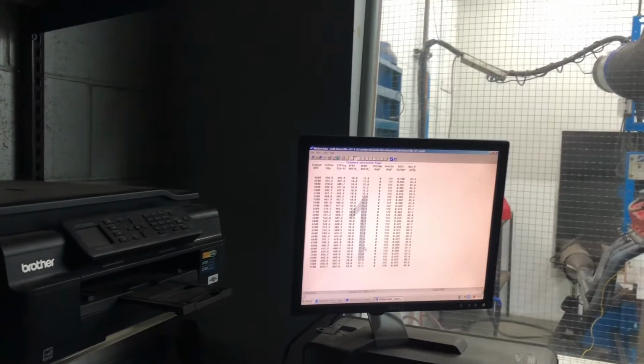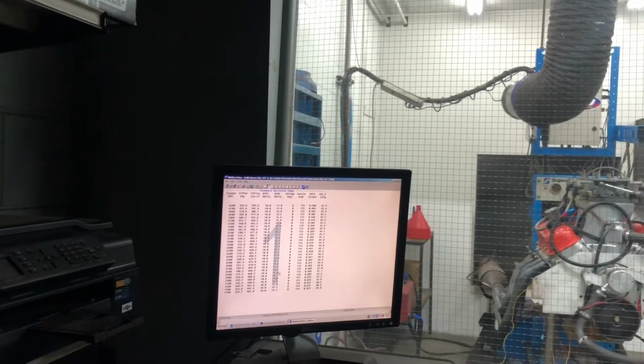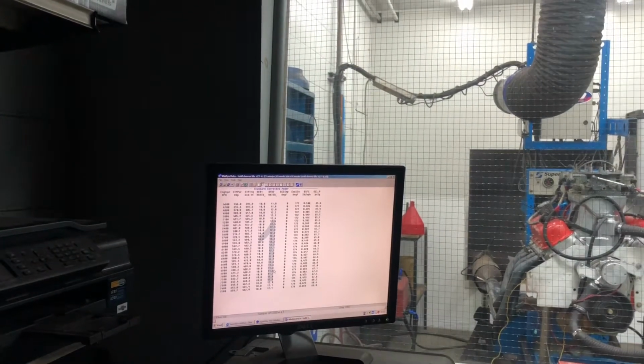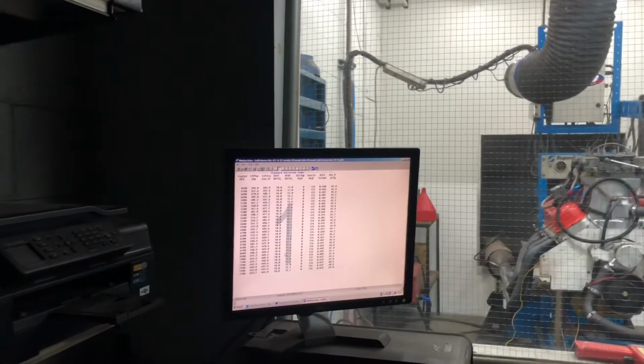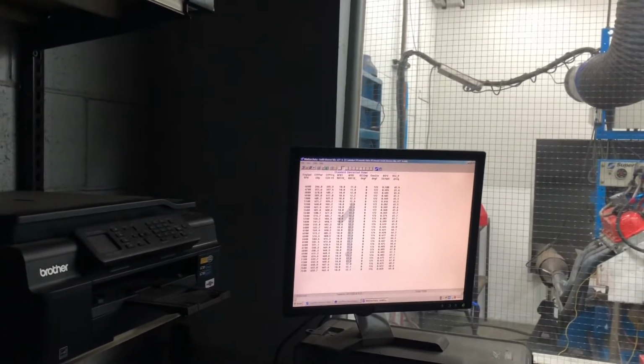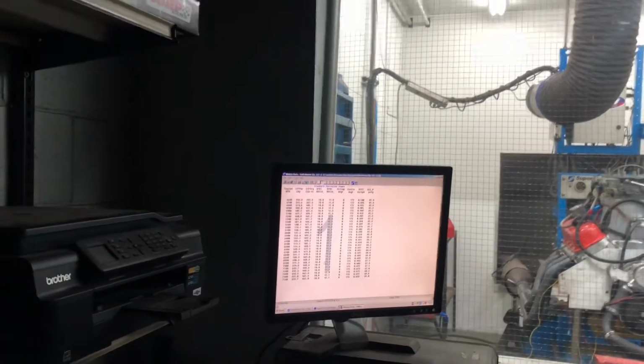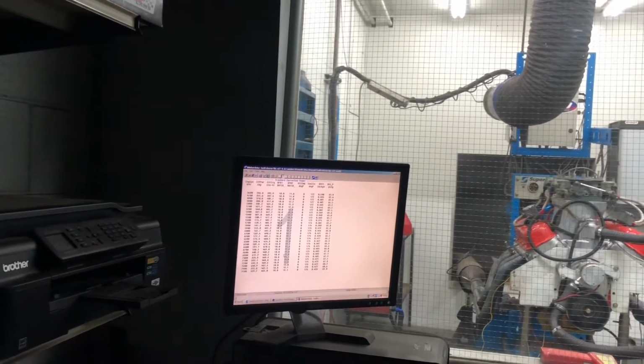It's going to make more horsepower. The more we rev it, the more it's going to make. If that goes to 8,000, it's going to make 700. Still, no, because it isn't climbing 50 horse for... Oh, I bet you will. We're already, what, 75? We're turning 7,500 right now. But 500 RPM ain't going to give us 50 horse.